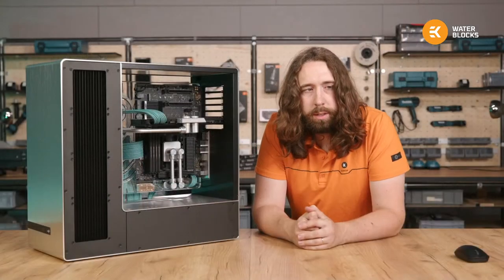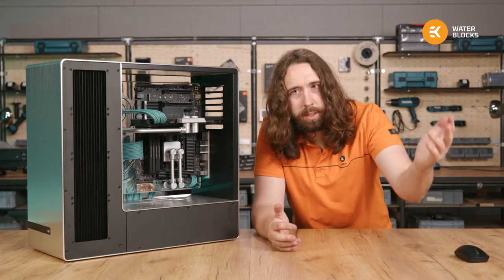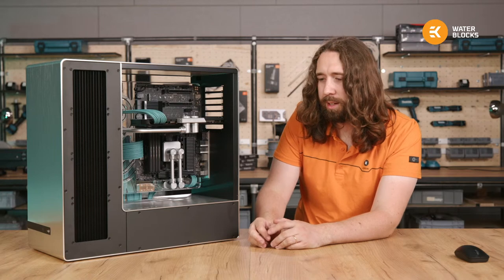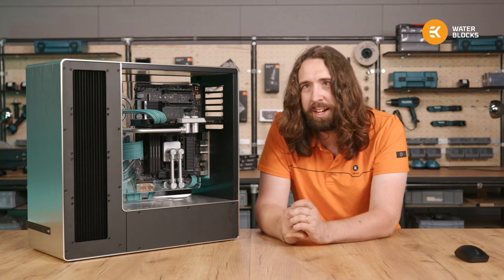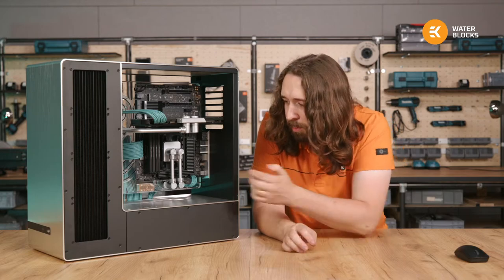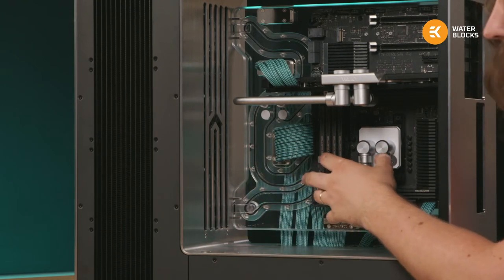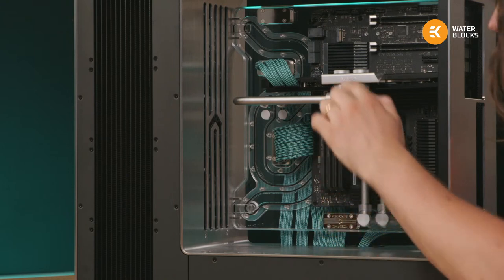TG, yeah, the 400mm DRGB, I obviously have millions of DRGBs in stock across the road in the EK warehouse, but no use because I have no controller. I don't want to add a controller either because I don't want to run a cable to the motherboard. It's that simple. If there's anywhere in the build I could avoid a wire, that's the option I took. If the board had a power switch somewhere on it, I wouldn't have even wired the power switch, but as it happens, it doesn't. And I thought this is a bit too nice to be using a screwdriver on the pin, so I did actually wire it.